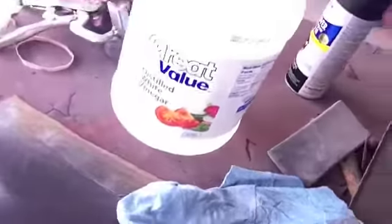It's still really sturdy but it is pitted, so most likely what I'll end up doing is just filling it in with a little fiberglass. The top's really solid — I'm not too concerned. But I think I'm going to go ahead and epoxy prime the top before I do any bodywork. I did make a little distilled vinegar and water mix and metal-treated it earlier, so my plan is to get some primer on that.